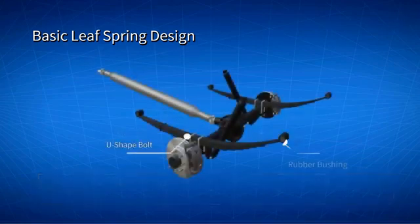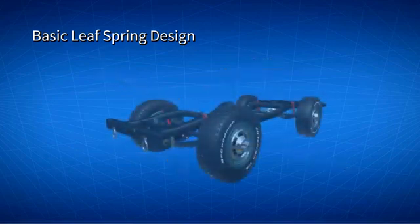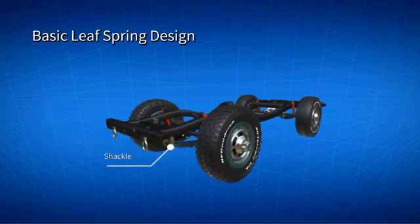Rubber bushings are used on the front and rear to reduce the impact from the road. A damper is also fixed in a clamp to dissipate the stored energy from the spring. The end of the leaf spring is directly connected to the frame by a shackle.